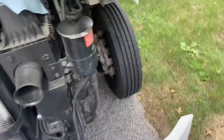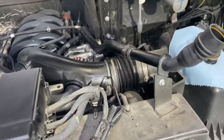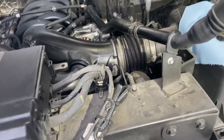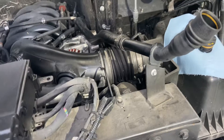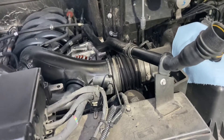The reason I like to wipe everything off underneath is so that next time you're changing oil — or if you're having an oil leak — you can just look underneath and see where it's coming from: whether it's the filter, the oil pan, or wherever. That's why I always try to keep it nice and clean under there.